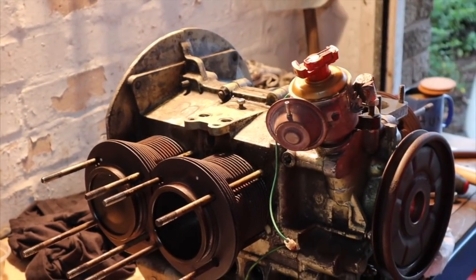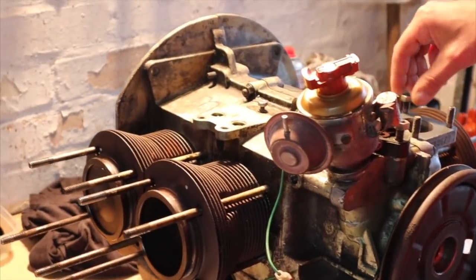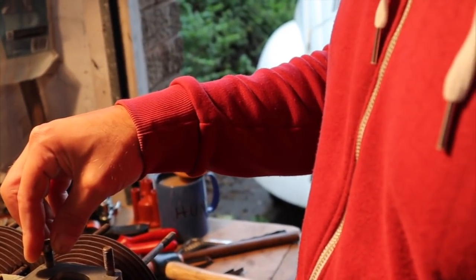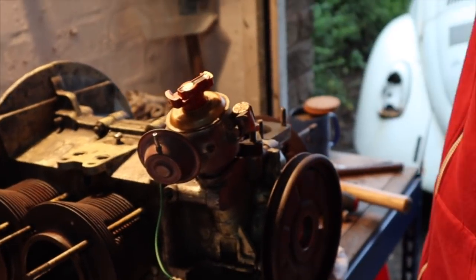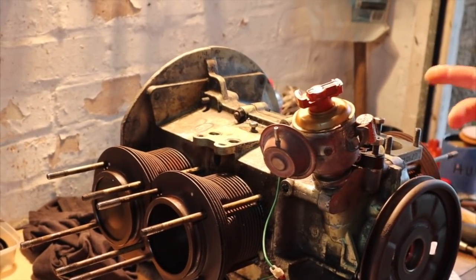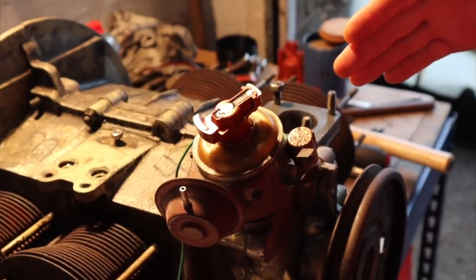I think it'll be completely arbitrary as long as it's firing at the right points in time. Arbitrary meaning that if this is in the right way, it will fire at exactly the right times, four times. It just means that it gets clamped down in the right position. Because top dead centre's there. Right, that's top dead centre, I believe, for cylinder number one, which is back here. And this bad boy, well, it's saying that now it's going to fire here.